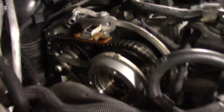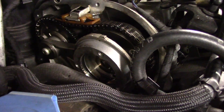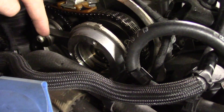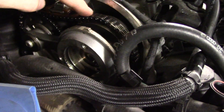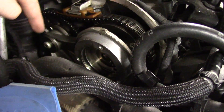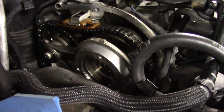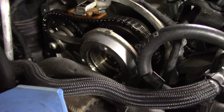Just one final note: there could be two possibilities as to why this timing jumped. Number one — what to check for when you pull this apart — this intake cam bridge has a little screen on the back. The screen blows out and can possibly clog the control valve or go in and clog the intake cam adjuster and the actual timing chain tensioner, which is a hydraulic tensioner. This thing had a low oil level, so more than likely the tensioner failed. We're going to replace all that when we do the job, but make sure you're looking at that screen.